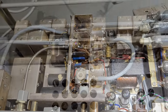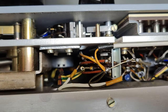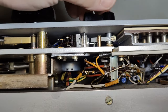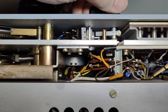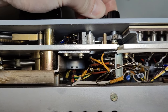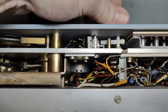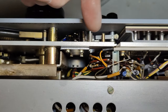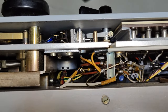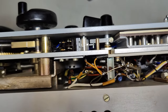I feel we should try and power this up now and see if it works. This is the bottom view and I found the mains on-off switch - that is that one. See when I move this one, there's a nice connection to the on-off switch, and then it leaves it, and then you got the AM-FM. Quite nice mechanical solution to save a switch on the front - it's like holes in the front cost money or taxes or something.